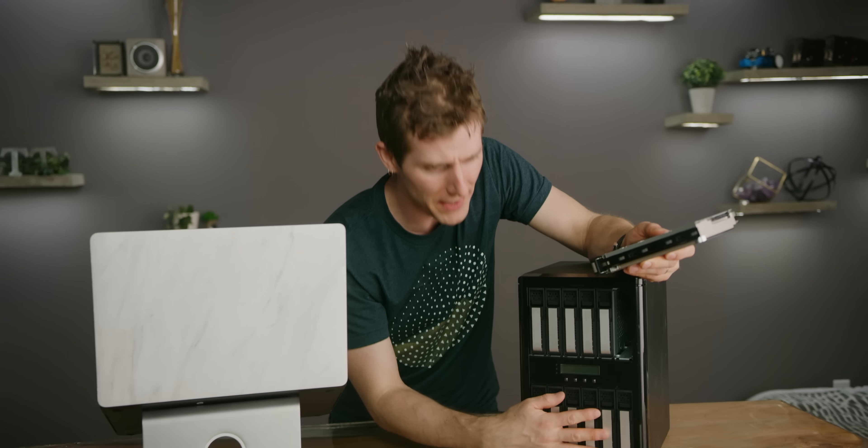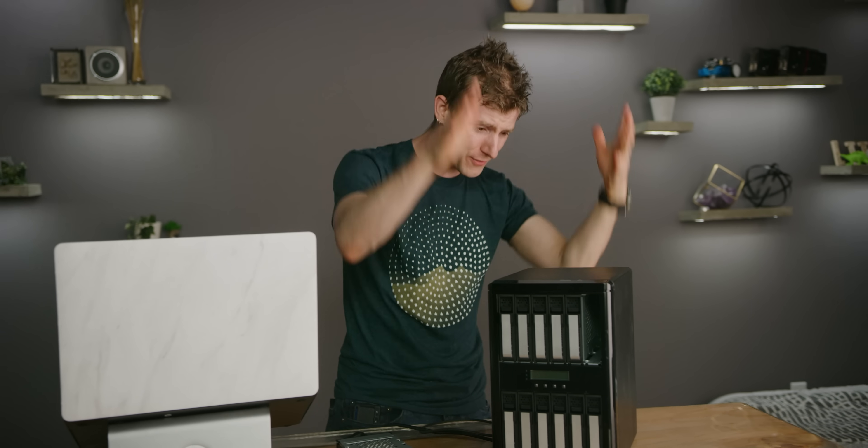There are ways to make mistakes though. They do have mounting holes for 2.5-inch drives, but I wouldn't recommend using those in a unit like this because you'll be compromising your capacity and performance. We actually prefer the empty version because you don't need to fill all of the bays right off the bat. On many DASes, if you were to add more drives later it would mean you'd need to reformat and recreate your RAID, which is pretty inconvenient when this is your storage locker for all of your stuff. Ours has what's called online volume expansion, so additional capacity can be used to enlarge the last volume set or create another volume set.